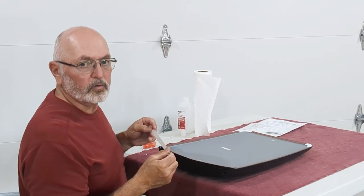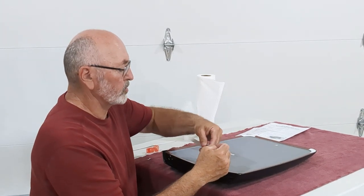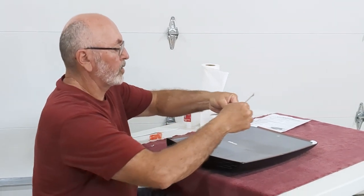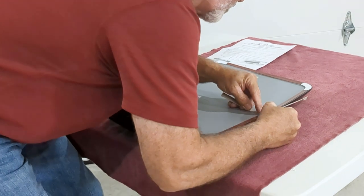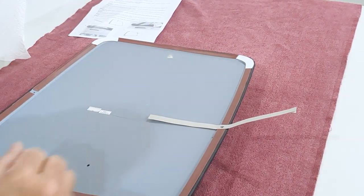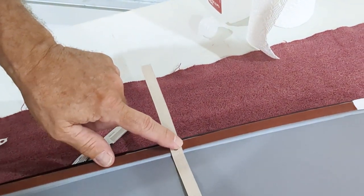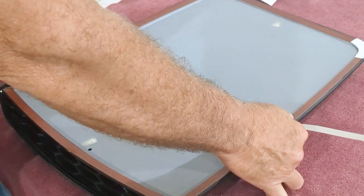The next step is to place the locator strips. The hole goes over the holes provided in the hood scoop to help you center your screws. The locator strip has a little bit of tape right in the middle over the hole — you remove that little square and center it over the hood scoop. Pull it into place, do the second one, and press them down good to make sure they stay.